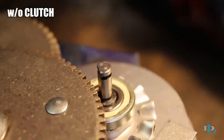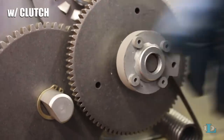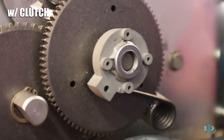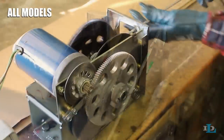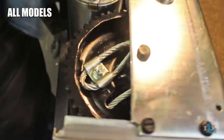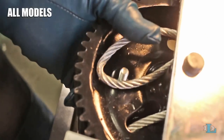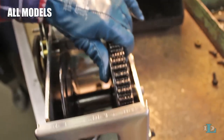Pull off the gear itself and set both it and the E-ring aside. If your winch does have a clutch, turn it clockwise so its end is pointing to the ground. Grab the end of your old cable and simply pull it all the way off of the winch's reel. Now grab a 7/16 inch wrench, then loosen and take off the nut that is holding the cable clamp in place. Remove the cable clamp and the carriage bolt, then pull the old cable out of the reel.